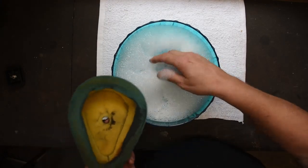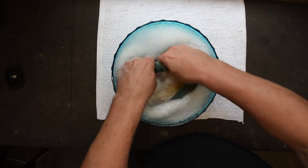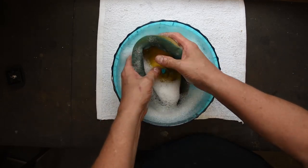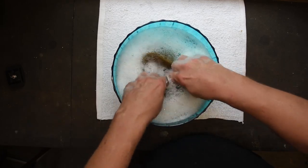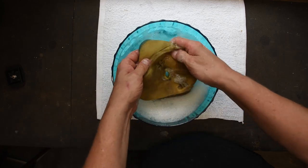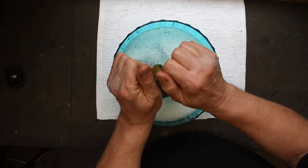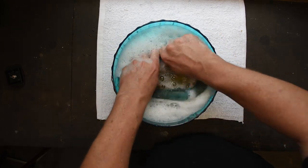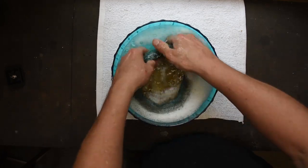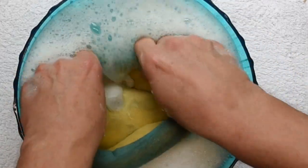So this little plastic retainer clip holds the filter in place. Put that in the parts tray and then this guy lifts right out. Here is the inside of your air filter — it's a foam air filter and it's two pieces. There's an internal cage and then there is this external foam filter, and this is the part that we're going to wash. Here we have a bucket of plain soapy water and I'm going to gently massage it. I'm not going to wring this — I'm just going to work away at it to try and get the old oil out. You can see as it goes through it's pulling out any dirt. See that — that's the old oil starting to come out of the filter.